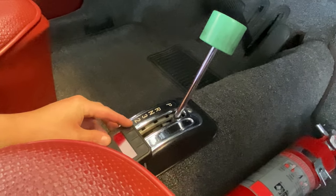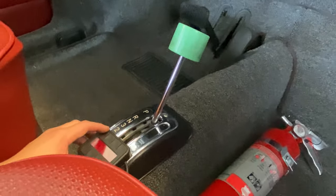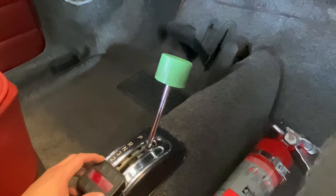The front suspension has been converted to a narrowed Type 1 beam with drop spindles and Monroe air shocks. The rear independent suspension is now running off of RideTech Shockwaves.